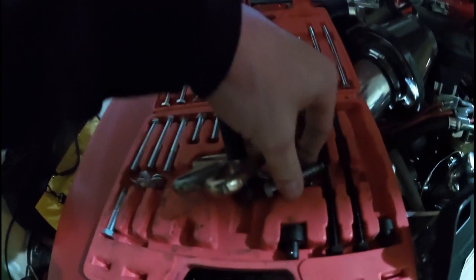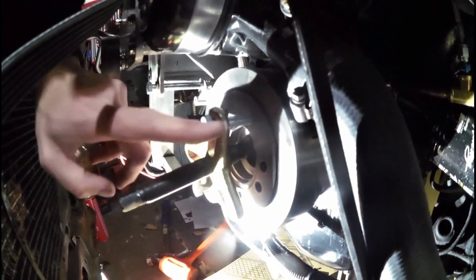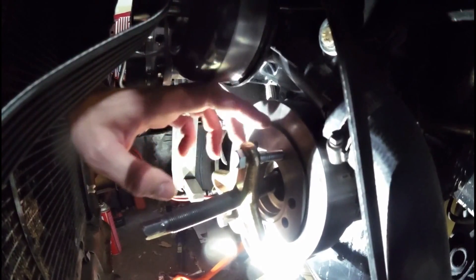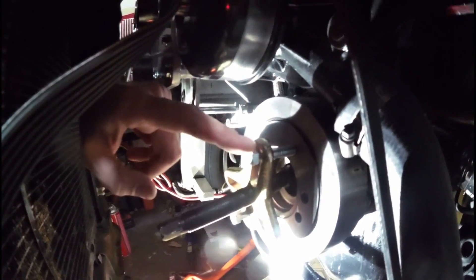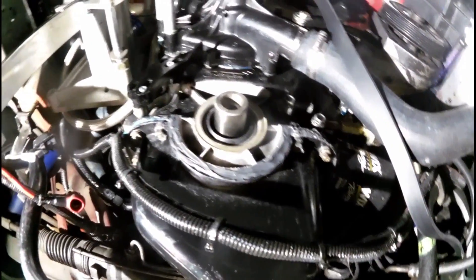This piece goes into the end of the crankshaft and these bolts attach to the harmonic balancer. I'm going to get it set up so you can see what it looks like. You remove your crankshaft pulley, get one bolt into the old bolt holes — two of them in here — and then when you thread this in, it pulls the harmonic balancer off the crankshaft. I've got mine out pretty much all the way, just like so.